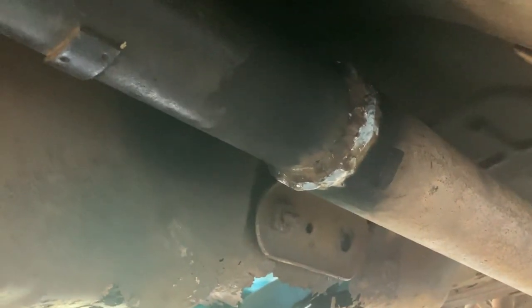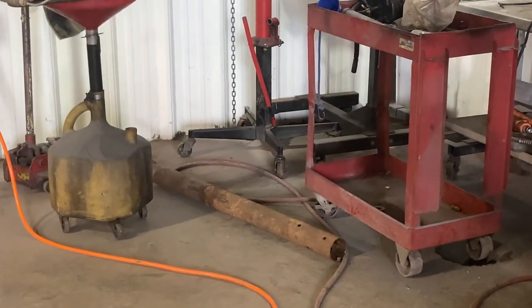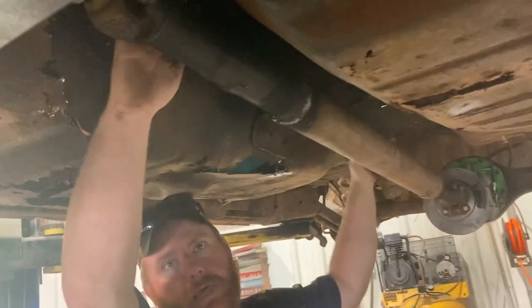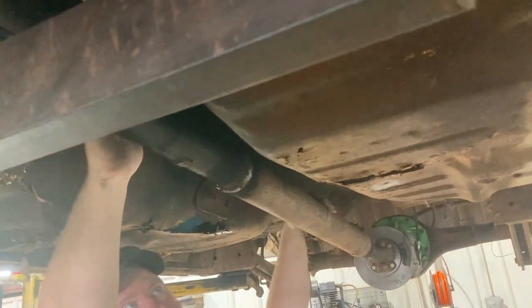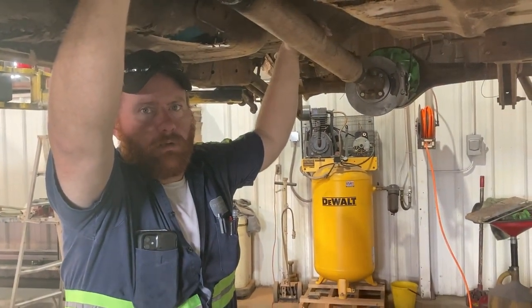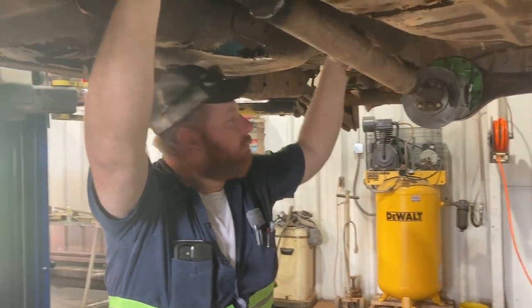So it was already put together one other time, and the old tube's laying right over there on the floor. So we cut it apart, took this. Of course, this spline slid up in the transmission, and we adapted it, made it fit this. It's not balanced. It ain't perfect, but for the speed you're going, yeah. They actually make a telescopic driveline for this application that you can buy if you want to. We figured this would be the first one, we would just kind of build our own and see how it goes.